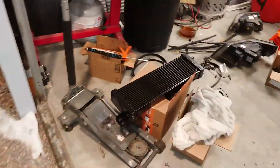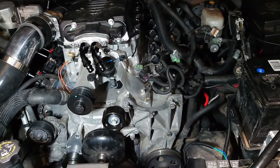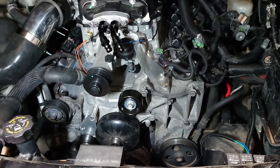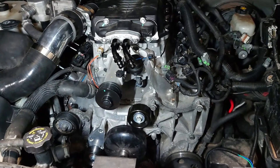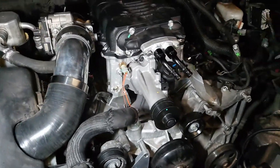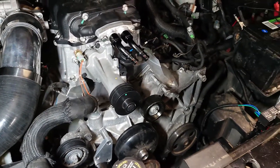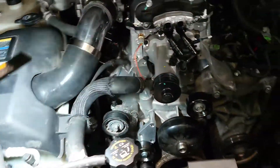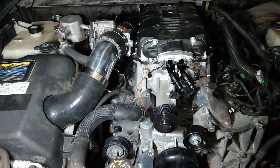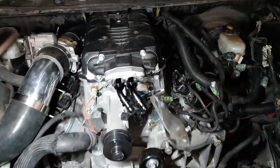In the next video, I'm going to have that done — hopefully some fuel rails, coolant done, hopefully have my belt on, and I'll show you what belt you need and how I routed it. Hopefully have this stuff powder coated — I could drop it off now since the intake is completely done. The only thing left I'm going to do is get some bungs to weld in here for a vacuum, and I got a catch can mount still. I'm going to run hoses from each valve cover into the catch can and the catch can into this pipe right here. As soon as I get that bung in, I'll weld it, and then be able to get that powder coated.